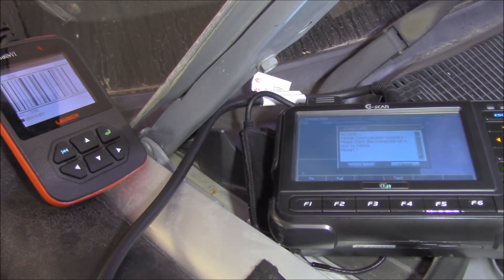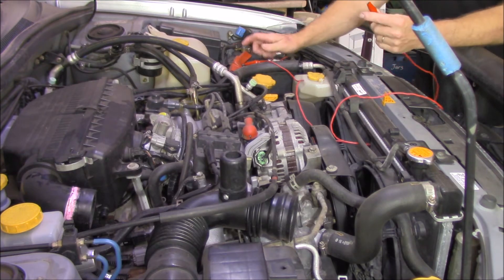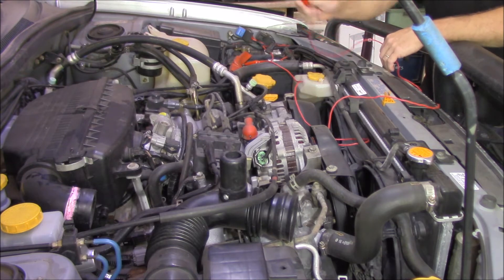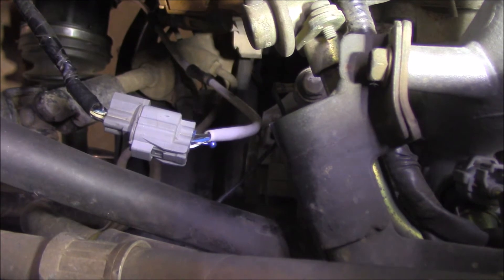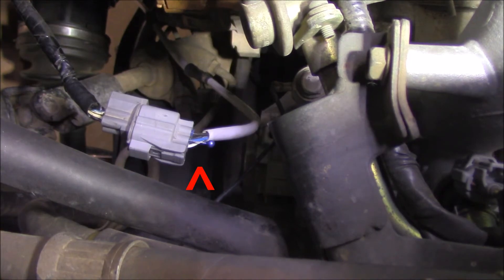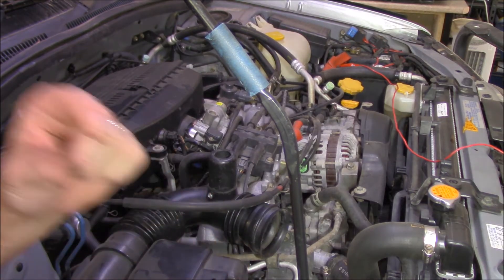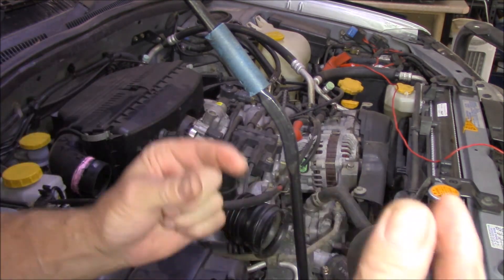Let's first have a look at the C Reader or the Launch. First things first, we'll need a positive lead connected to the positive side of the battery — that will make sure you don't short it against anything. And as you can see over here, I've put a dressmaker's pin into the sensor wire. That is the signal wire heading back to the ECU. So at this point, all I'm going to do is put a bit of saliva onto both fingers — onto these two and these two, they're now wet.